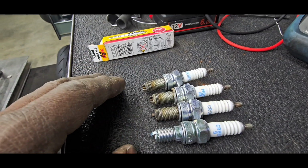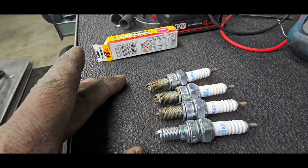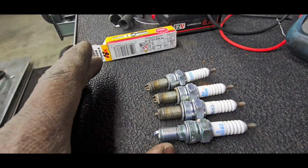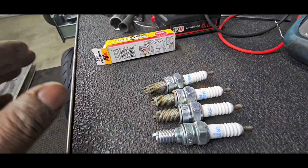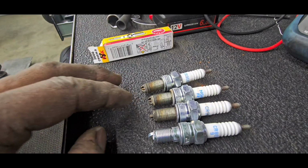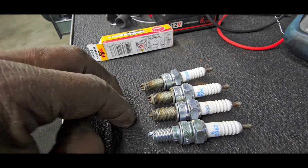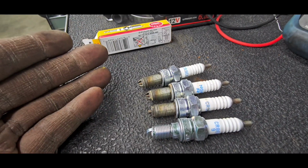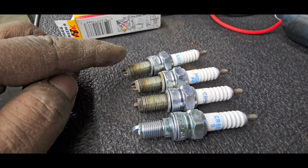And they maybe even pop their head up and crane and look around the room for their mentor who's on the phone or buried under a motorcycle or dealing with customers or even out of the shop. And they figure, you know what? I'm not going to bother my mentor for this. I'm just going to seal up the bike and let it go. So they seal up the bike, they put the caps back on or the spark plug coils back on, the bike starts, it runs, and as long as it rides out of the shop, well, then the apprentice feels like they've done a good job. So that's the first way that spark plugs, 3 of them, can be consistently installed wrong.